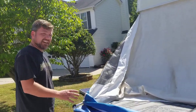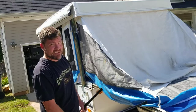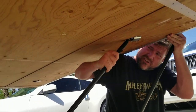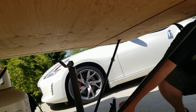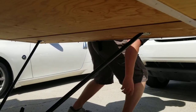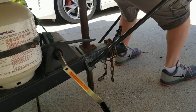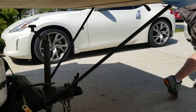At this point we're really ready to start setting up the bed. Grab those two black poles off the ground. Underneath there'll be a spot they fit into — slide them in, maybe use your shoulder to get it up in there and just let it hang. Notice there is a hole on the trailer itself that these poles are going to fit into. You have to have the bed all the way out. If you crouch down and crawl underneath — it's not very heavy — you can use your back to lift it up and it slides right into that hole. Same thing on the other side. A little tricky the first couple times, but hold them in place and that bed is secure.